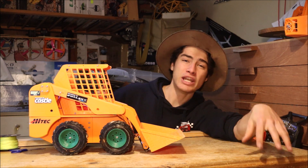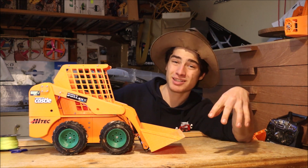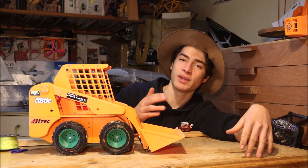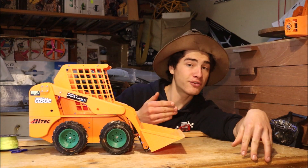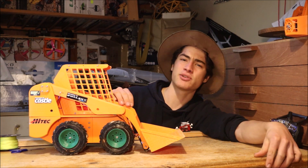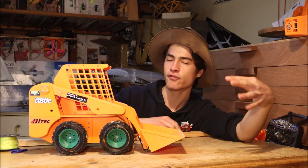So that was pretty awesome. I know it was very quick — this thing is a bit underpowered at the moment. I need to put some bigger speed controllers in. The front two wheels are underpowered, so when you turn it doesn't really turn with a load, and going backwards is very, very slow. But it drives forwards fine. As you can see, it could pick up some dirt. I'm very happy with how much it can lift — it can lift this thing full of gravel, not piled out, but plenty enough for an RC Bobcat.